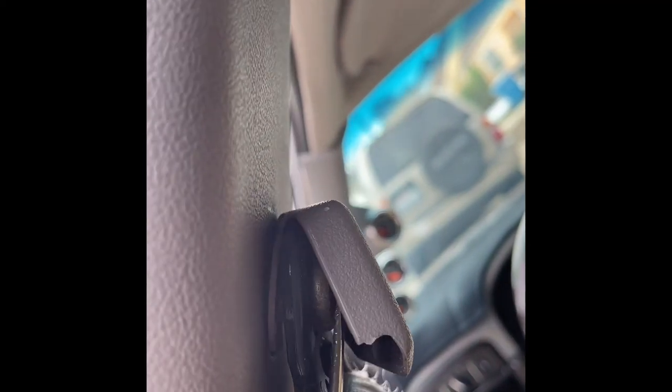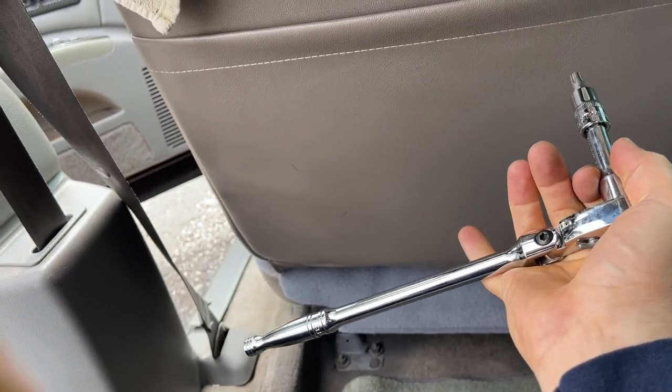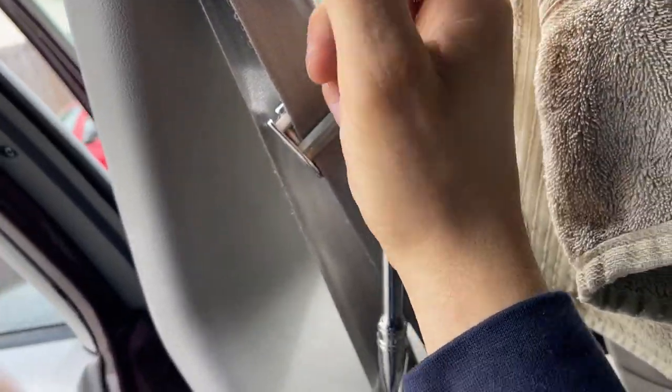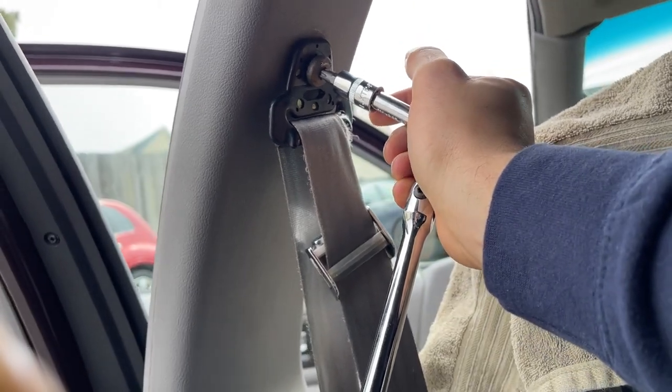So this piece I had to take off — it's going to have a little clip inside. All you're going to do is take a pocket screwdriver, find this little indention, lift it up and pop it off. Get it from underneath here. Now I'm going to take my TP45. You could take an impact tool, but what you want to do is press it in as firmly as you can, then turn it counterclockwise — and that's how you should be able to take it off.